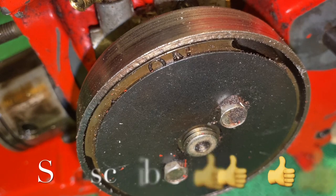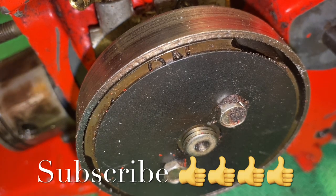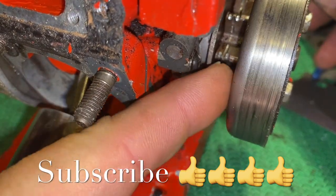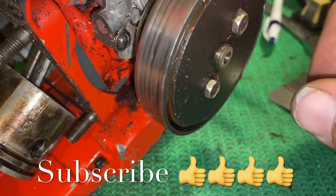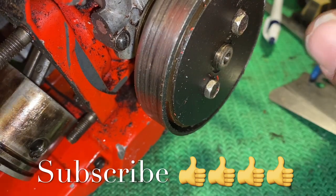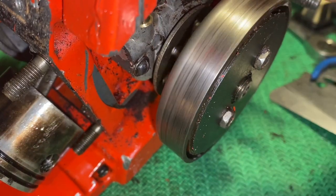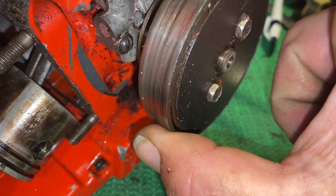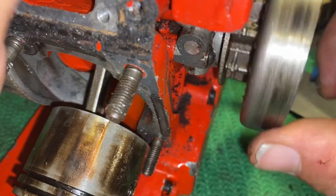This is just one style here. This part here would basically be considered your sprocket, this would be the clutch drum, and your clutch assembly would be inside here. See how this spins freely — that is correct, it should spin freely. It's normal to have a little bit of play there, but the chain rides on there.